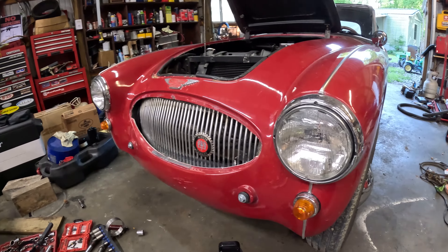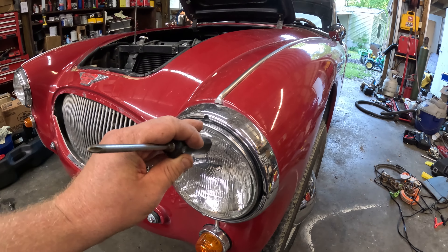Had to put an engine in it when the owner first got it. So now it's out here due to typical kit car stuff: electrical issues, the exhaust system is practically falling off, and some other piddly stuff we've got to figure out. It doesn't have functional horns or anything like that. Right now we're working on lighting because the taillights and stuff work, but nothing on the front works. I'm going to start pulling things apart up here, checking wiring and electrical connections, see if we're getting power up here, or if we've just got a ground issue.